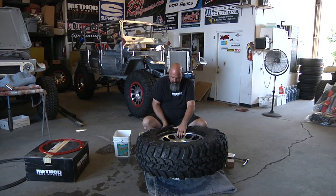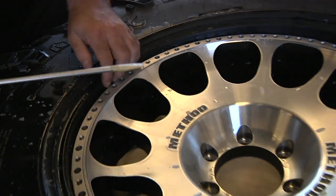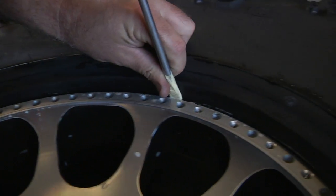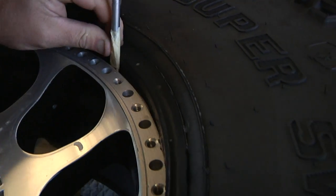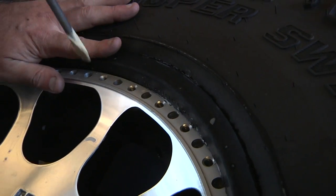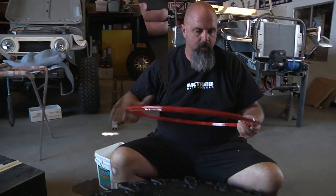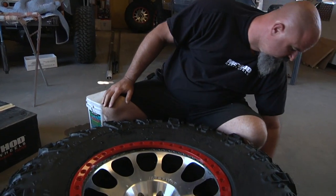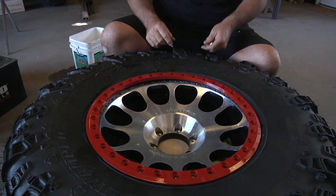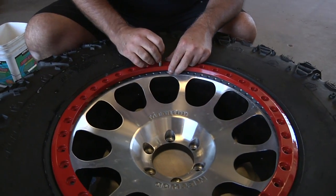Now we've got the wheel up. We just use a five-gallon bucket with a little padding on there to help protect the wheel. One thing you want to take care to do is make sure that the bead goes down around the wheel all the way around. This can sometimes fight you, especially on these big 41s. Make sure none of that tire is up on the top. Sometimes an extra pair of hands helps for this part. What I usually do is get four bolts that are about a half inch longer than what I'm using and put those on opposing corners to help keep the wheel true as I'm walking it down.